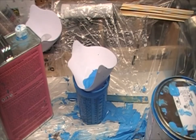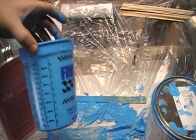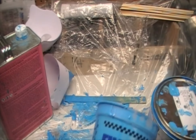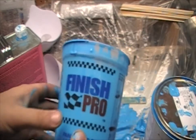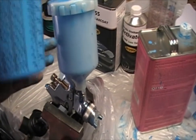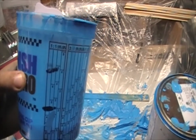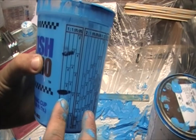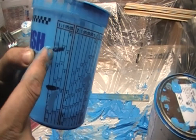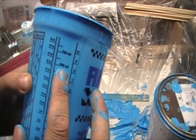Now that I've got these mixtures down, I'm going to share them to make it easier for you. This is what was recommended when I bought the paint. You get one of these cups — usually clean like this — and they've got all the different ratios on them: 1 to 1, 2 to 1, 5 to 1, 6 to 1 to 1. What I've found fills these standard-sized pots just perfectly: you want to do 5 parts paint and 5 parts reducer. Sometimes a little less reducer or a little more paint doesn't hurt, but keep it right about there because that puts you at about 600 milliliters, just under.